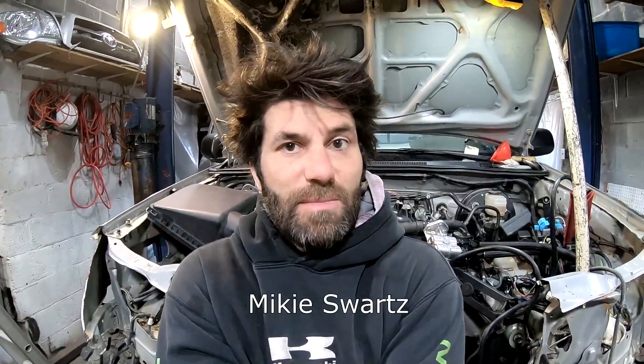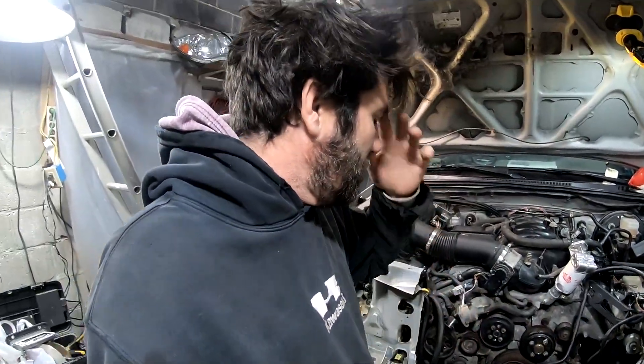I really haven't been filming much — mainly just troubleshooting, and that's kind of boring and hard to film. But today I want to recap. When I finished the wiring, the first thing I noticed was that when you turn the key on, the fuel pump runs constantly. It shouldn't do that — it should turn on for a few seconds and shut back off, or not turn on at all until you start to crank the engine. I don't really know why it's doing that, but anyway I decided to just move on.